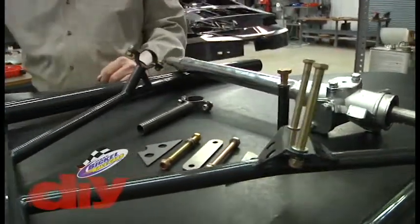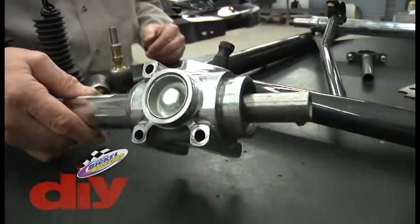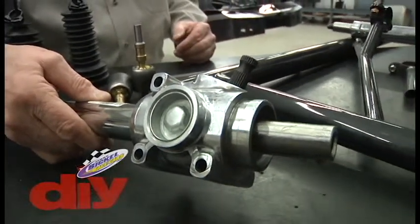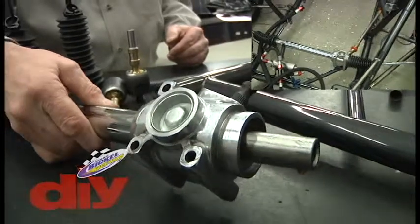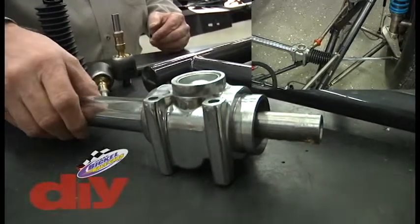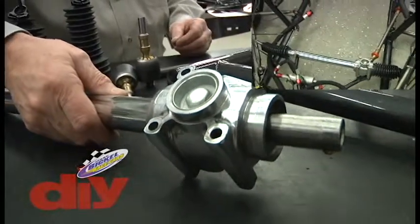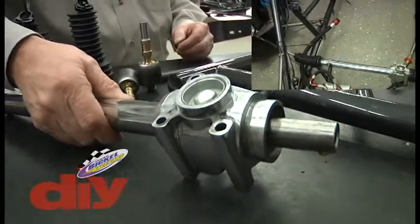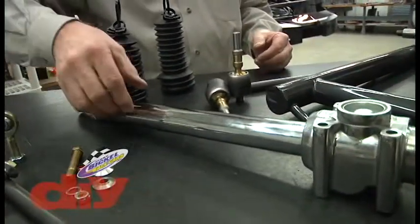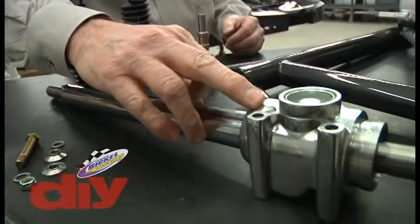That rack unit is shown here. As you can see, it uses a whole different gearbox design that mounts to the one that was on the display chassis. It's a billet gearbox. The unit itself, while being quite a bit smoother in my opinion than even the earlier Pinto style, utilizes a gun drilled shaft through the unit, which lightens it, and a slower reduction gearbox.